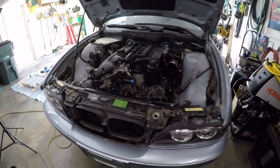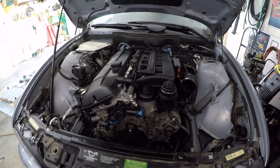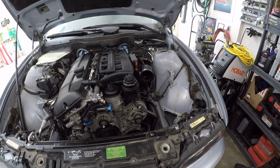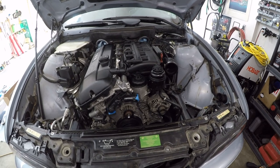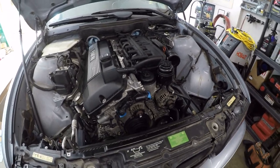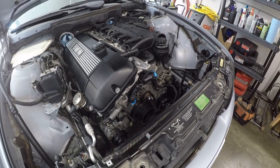Getting back to the video at hand, we're going to be replacing the entire cooling system — from the radiator to the fan clutch to the water pump, everything. That's because this system is made up of lots of plastic parts, and that plastic gets brittle over time and with miles. As it goes through lots of heat cycles, it just gets old and deteriorated, and it can leave you stranded at the side of the road if you don't keep on top of it.